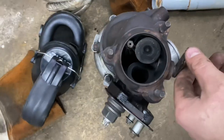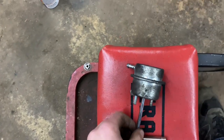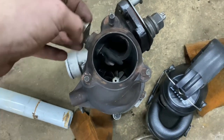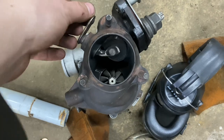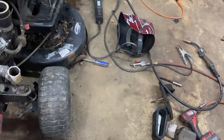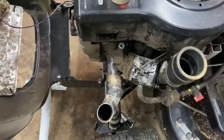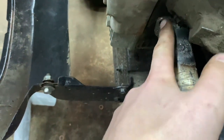I also took the wastegate off — it's right here — and the actual wastegate itself is right here. I'll probably put it back on just so it keeps tension and holds boost pressure. When it's resting like this, it keeps the wastegate closed, so all the boost the turbo makes, the motor gets. In the future I might have a different system, but for now this works. I still have to make an exhaust flange, figure out where that's going to go, and figure out an air filter. I also need to make a mount for the turbo because the pipe isn't very strong.